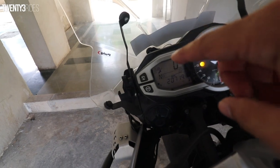The battery issue was definitely not the cause, because the whole console lit up — you can see the whole console lights up. One of the biggest indicators of a battery issue is that when you hit the starter, your instrument cluster lights will also be dim, which would mean the battery voltage is low and not getting adequate power. So the battery issue was ruled out.